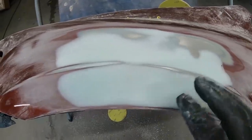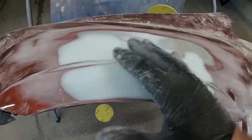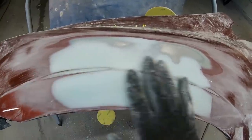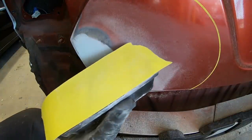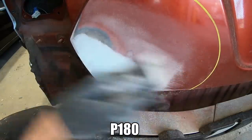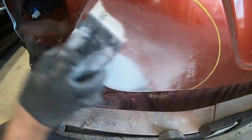After 180 it should look something like this. I prefer to feather onto OEM paint as long as it's sanding well underneath with at least 180 grit — I feel like you're going to have a better transition. A lot of guys decide they really want to feather into metal only, but I think it makes for a nicer transition because you don't see the edge and you're not depending on your primer to pick it up. At any rate, we're going to leave this in 180 and block out our other two dents. I'm back here on this dent — it's okay if it overlaps a little bit, and I'm always a fan of replacing the paper if it's not cutting. Going one direction and then finishing the other way for cross-hatching makes for a nicer, smoother repair.